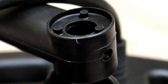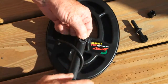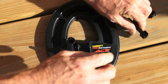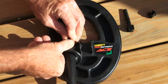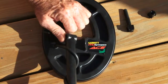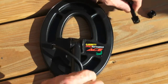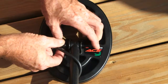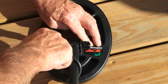In the area where the grommets are inserted, just press those down in there — line them up with the pegs. Turn it over to the other side and do the same: line up the notches cut into the grommets, press them onto the pegs, down into the recession of the wand. Make sure they're in there, then bring the coil into place, pinch the grommets in position as you press it down, insert the nylon bolt, and put the retaining washer on.